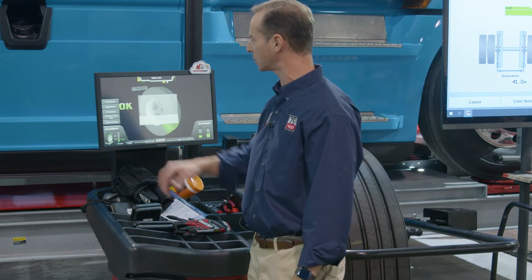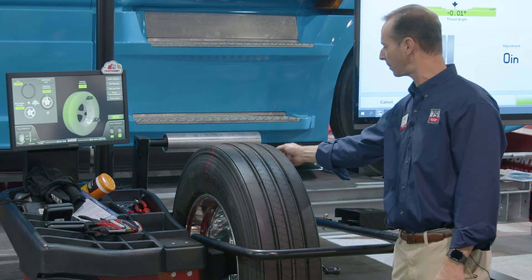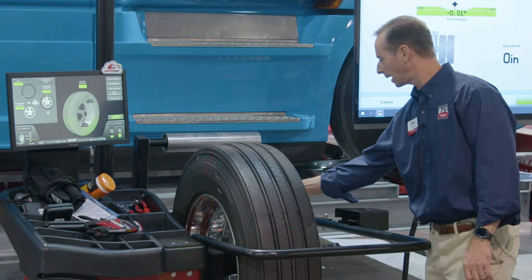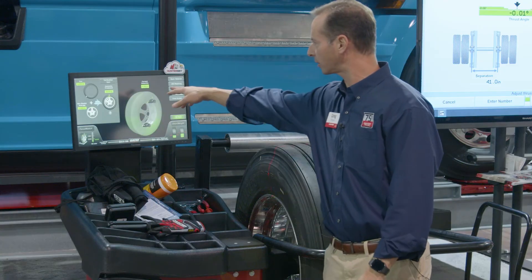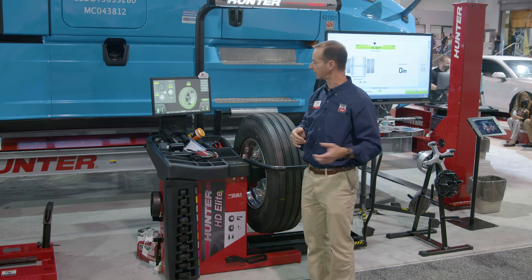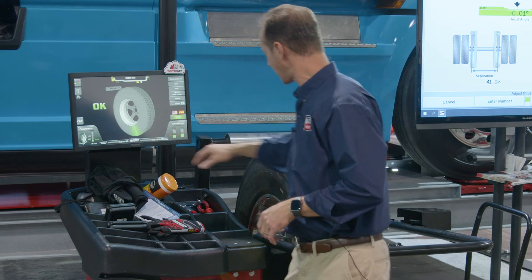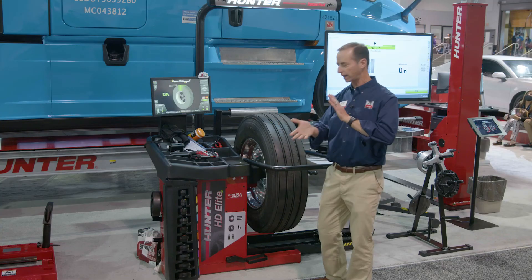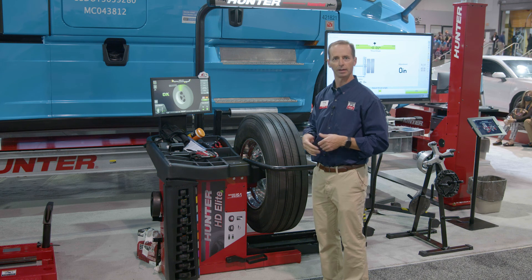But if there was a problem, I can go into the force matching screen and it's going to show me exactly how to improve this assembly. It's telling me to make a mark on the tire right here, and then I can servo the rim position into position. It's telling me to make a mark on the rim right here. I can take this assembly to Jim's tire changer, turn it, and get the run-out down from 33 thousandths to 12 thousandths. In this case we probably wouldn't do that, but if we were going from 90 down to 70 or 50 thousandths, that would be worthwhile. I can also mark this high spot — this green mark right here is the high spot of the assembly. I can bring that to 12 o'clock and mark it, so when I place it on the truck next to its other dual assembly, we can make sure those are opposite to get the best rolling assembly possible — maximum tire life as well.